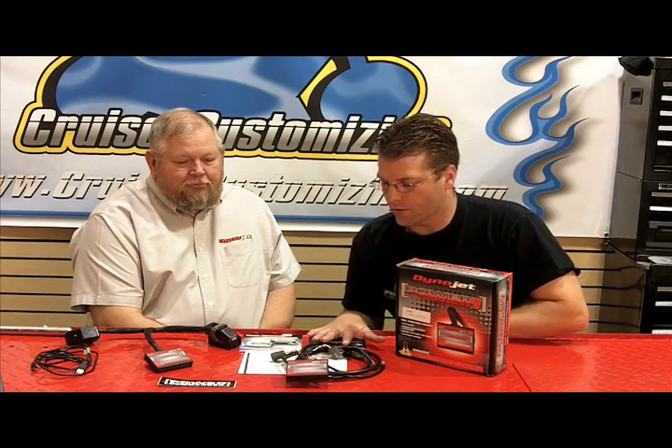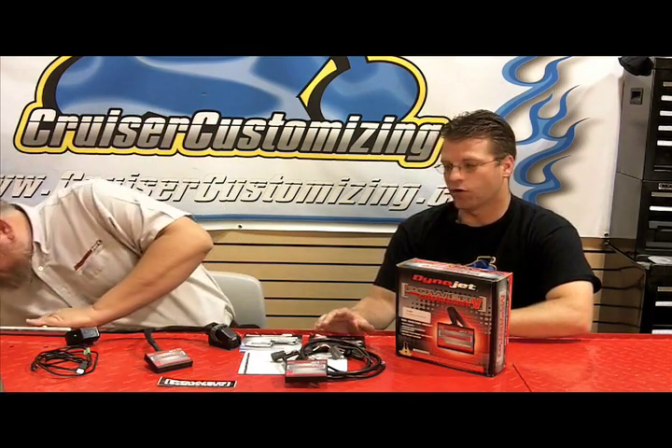There's one piece that plugs into the Power Commander 5 that I find absolutely extraordinary, and it's called the Auto-Tune. The Auto-Tune unit allows us to plug into a Power Commander 5 and install an O2 sensor into our exhaust system. This is a special O2 sensor that measures a wide range of air-fuel ratios versus what you may find in some stock motorcycles. This O2 sensor lets us adjust things for performance, and by plugging it into my Power Commander 5 through its Auto-Tune box, it will allow me to adjust the fuel to the exact parameters I set — the same as if I put it on a dyno and actually dyno-tuned it.